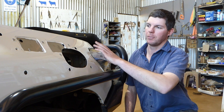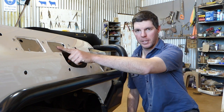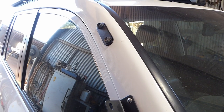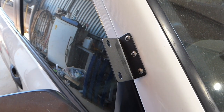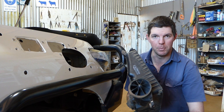So we're at the point now where we've got all the holes cut in the guard, everything's painted up, we've got the insertion plate here that covers up the original factory raised air intake holes. We've got the factory holes in the A-pillar covered up with a bracket supplied in this kit. We've also put the new bracket on the A-pillar, and the next step now is to get hold of this air box and start modifying.